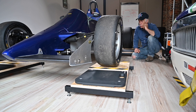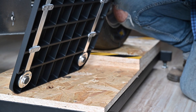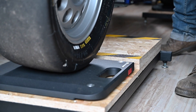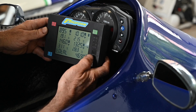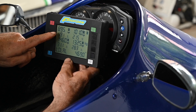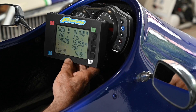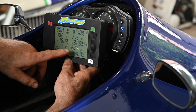Now let's roll the car onto the scales and take some basic measurements. The total weight of the car with me inside is 469 kilograms, or 1,037 pounds. In the front we have 90 kilograms on the left and 101 kilograms on the right — that's 19.2% versus 21.5%. In the back, the left rear wheel carries 31% of the load and the right rear 28.2%.